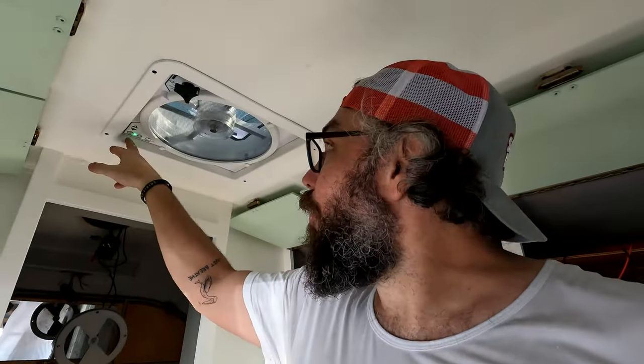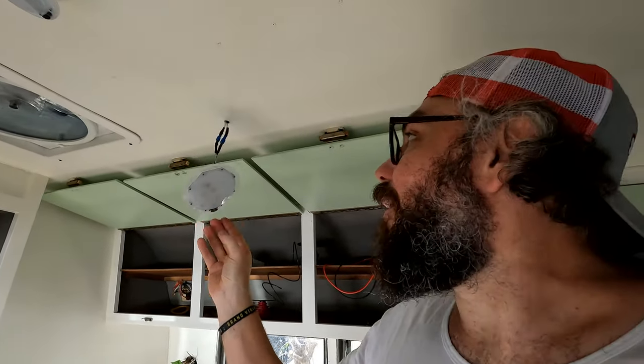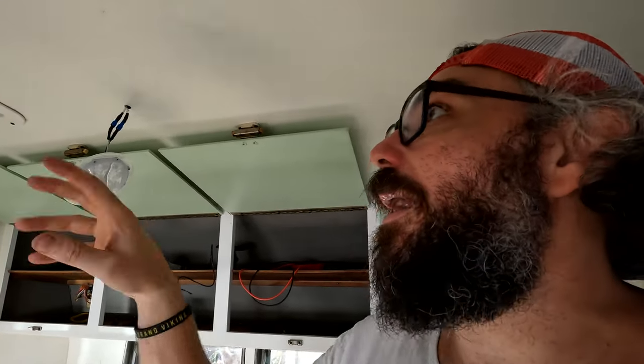The upper circuit being 12 volts is awesome because that means I don't have to run new 12-volt circuits all the way along the floor underneath the cabinets. Today I got this ventilation unit connected - it has an auto setting so it'll just suck all the warm air out until it gets to 75 degrees and shuts off. There are actually two of those and they're both connected now. I'm putting in some little lights that have a black surround so they'll match with the whole look. I spent yesterday touching up paint - the rivets that came undone meant the paint didn't go over the silicone like I'd hoped.